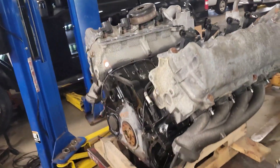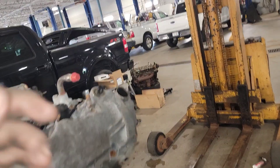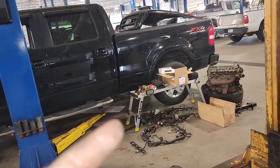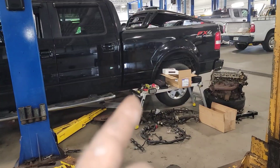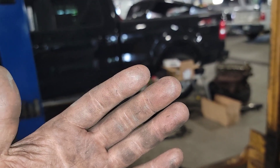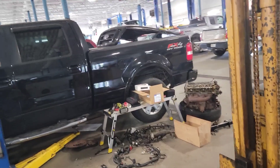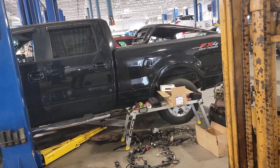I will have the engine installed tomorrow and hopefully have this thing running with no further issues. We were also looking at replacing the fuel pump on these because the fuel pump on these models did have issues — they would intermittently drop out and show erratic gauge readings. At some point in the mid-2000s Ford actually had a TSB or SSM that came out for these 5.4s, where the potentiometer on the fuel sending unit would get varnish buildup, and they wanted you to run a couple bottles of Techron through it to clean that off. It seemed to work for them. This one's showing the same characteristics, but the customer said he just wants it replaced, so I'll end up dropping the tank and putting a new fuel pump in it.